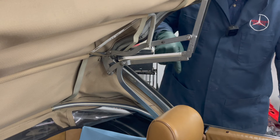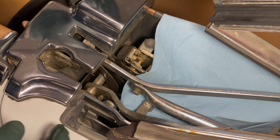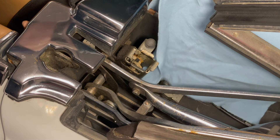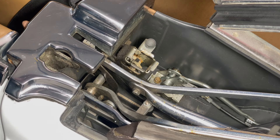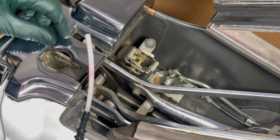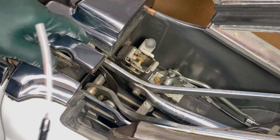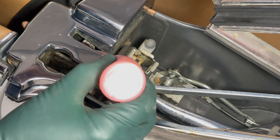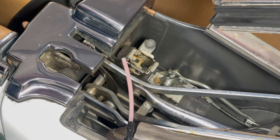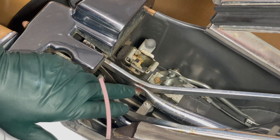Now I've got to tackle what's down in the hole here. It's going to be a little bit harder for you to see every detail — it's really difficult to angle the camera. Notice the blue cloth — no drips. I'm going to start with this big hinge point right here on this arm. If it's really filthy and dirty down in there, you might want to clean that with some mineral spirits or solvent before lubricating it. I'm going to put probably five drops on this one. I don't care if a little excess drips down here — I can wipe it up later. There's another one right here. I just get a little drop on there, then come down and lubricate this on both sides.